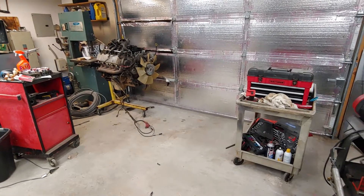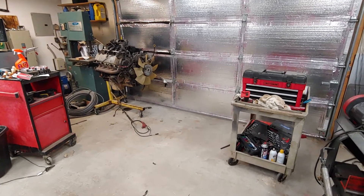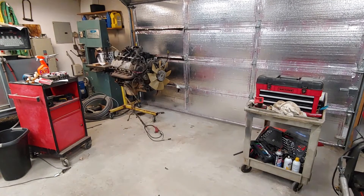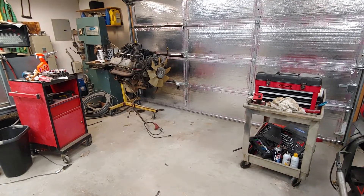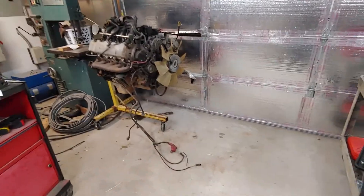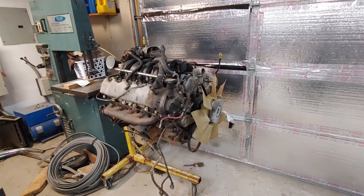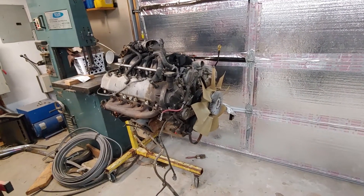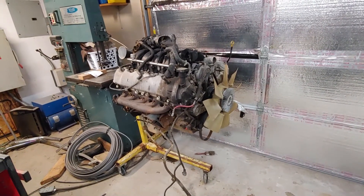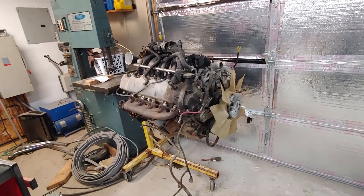The other reason is my 2002 F-350 Super Duty, which was sitting in the garage for three months because the radiator that a body shop put in when the truck was repaired in 2017 failed. That radiator had an integral transmission cooler, and coolant got into the transmission oil, which then contaminated the clutches and wiped out the torque converter clutches. It's a five-disc torque converter and it no longer had lockup.